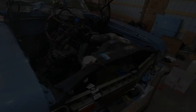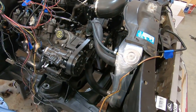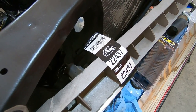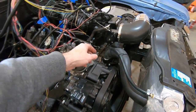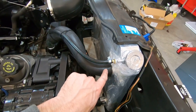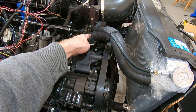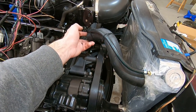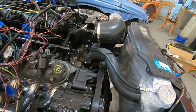Let me turn the camera around and let you see the hoses. There you can see the upper hose, and there's the lower hose down there. Both hoses are the Gates part number 22-437. But we did have to cut them to fit the upper one. Now the hose inside diameter is an inch and a half, but this tube on the water pump is inch and a quarter. So we did have to get an adapter — it's just a little rubber hose adapter. You can get them at the parts store, though we had to order it because they didn't carry it in stock.